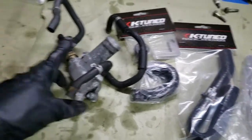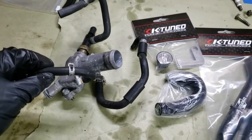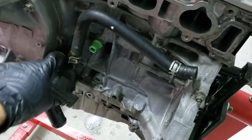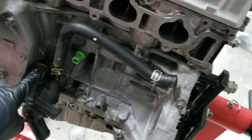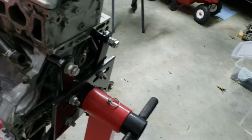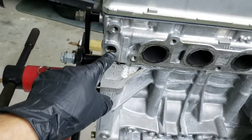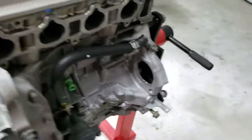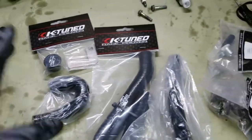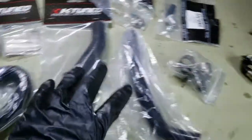So now we're going to get into a little bit of upgrades. This is our coolant outlet housing — we've got to put that on with a new gasket. We just want to do away with all these unnecessary hoses. We're getting rid of this metal pipe that used to come here and go back to the heater hoses — don't need those. So we've got a block-off for that. I've got a silicone replacement for this hose, and a block-off for this sensor that goes on top of the water outlet. I've also got a block-off for the heater lines — deleting everything I don't need, and everything I'm retaining as far as hoses, I'm going silicone. That way we won't have any trouble with them in the future.